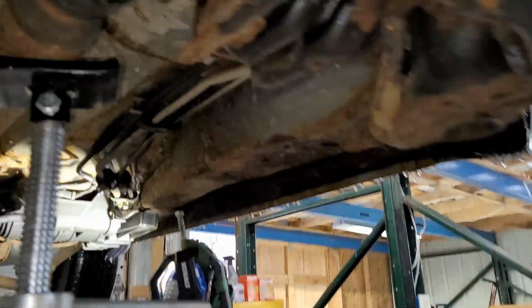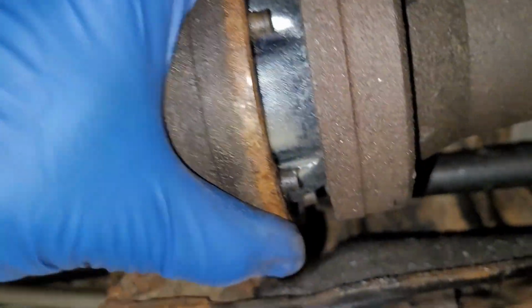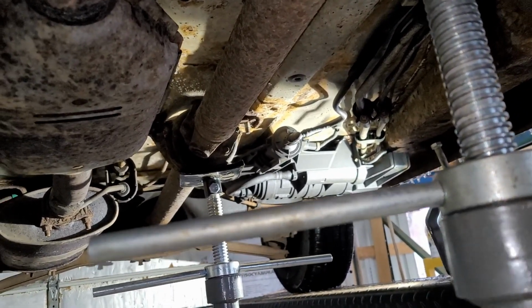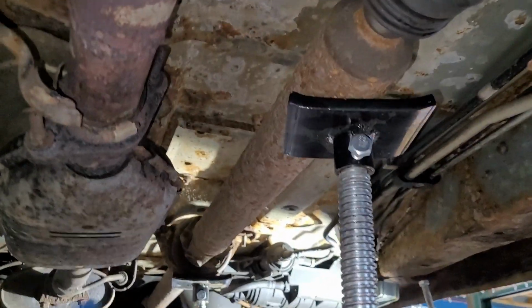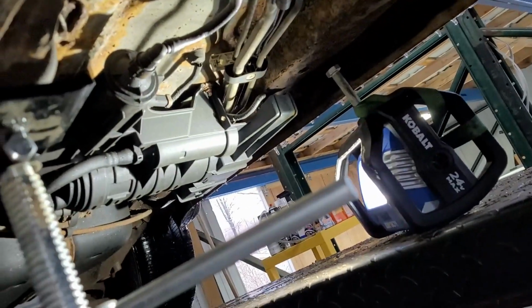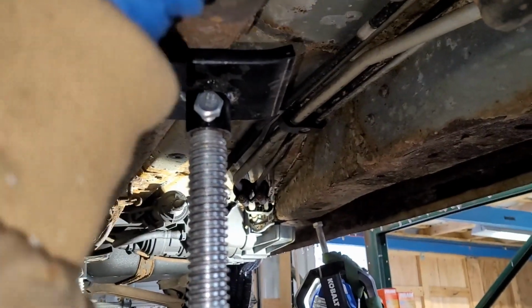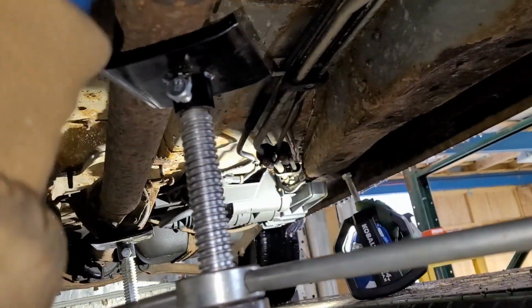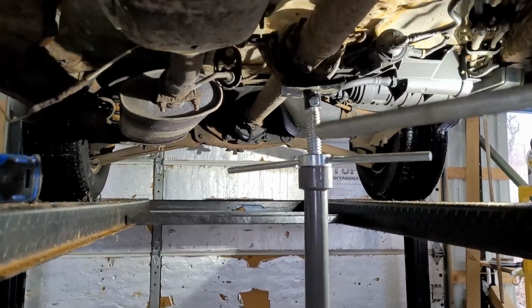Okay, I slid this back. See that cup? That has those ball bearings in it. Do not let that cup come off of there. So right now all I have to do is pull the back real quick. Actually, probably just lower the carrier bearing. I'll probably bring that right out. All right, down a little bit with this. I'll bring the carrier bearing down, and they'll roll right out. Don't want that dropping out. All right, I still have to get the backs out of there.